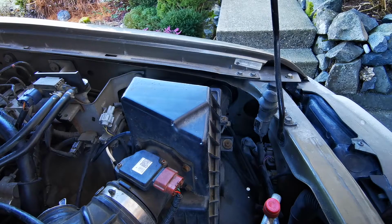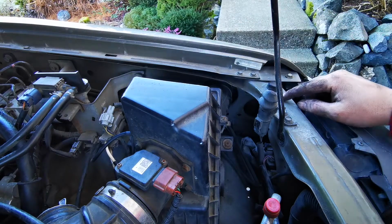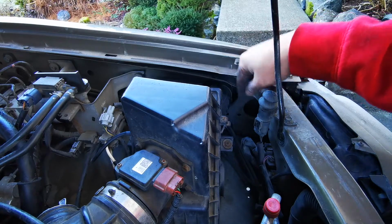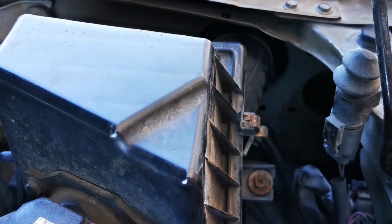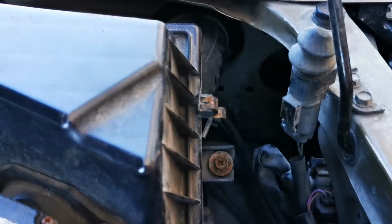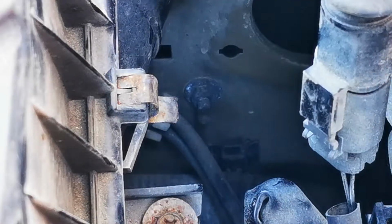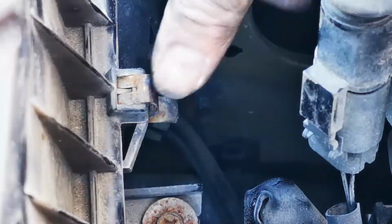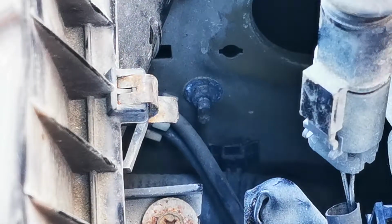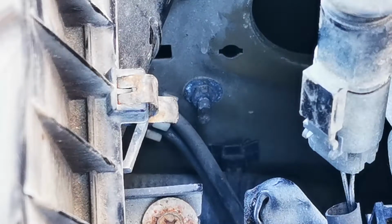So before we put the T-pipe back in, we need to remove the baffle that's in the fender. And to get that out, there's one 10mm nut on a stud just in the fender here. If you can see it, try to zoom in on it. Yes, so that guy right there is a 10mm. We'll undo that all the way and then push that stud right out through the fender, and then we'll work on removing the liner so we can pull it all the way out.